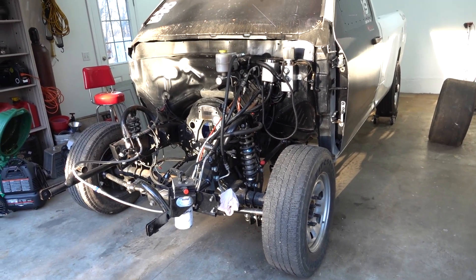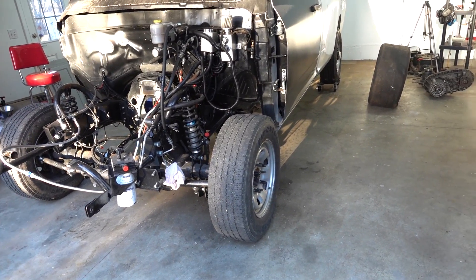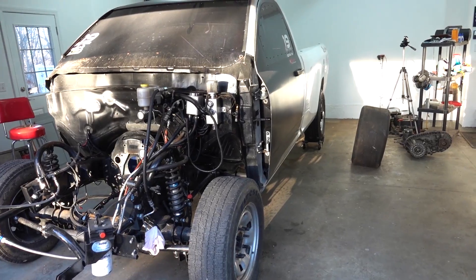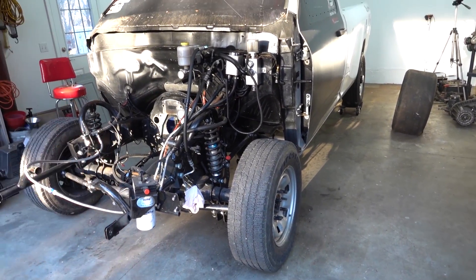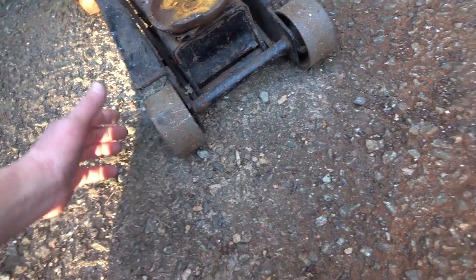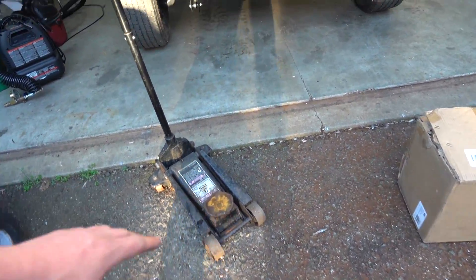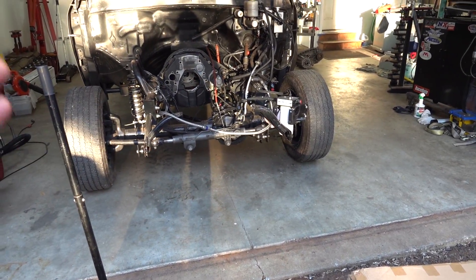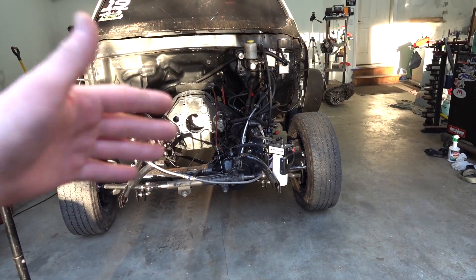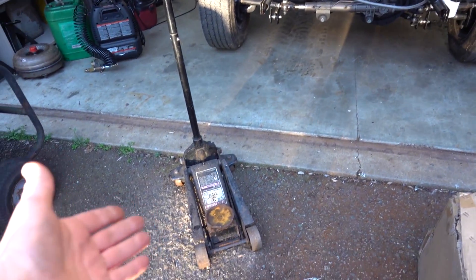While jacking the truck up on a rough surface, I had this happen in Crossville. We had to pull the transmission to swap our torque converter. What will happen is, you'll jack up one side of the vehicle, put your jack stands under it, and then go to the rear of the truck and start jacking that up. With your traditional jack, these little steel wheels — something like a little rock — will make it hard for this thing to move. While jacking up the rear and the vehicle coming up, you actually end up pulling the vehicle backwards.